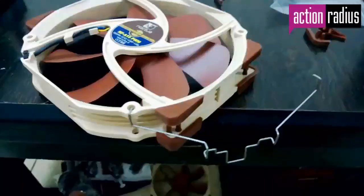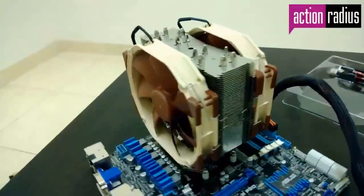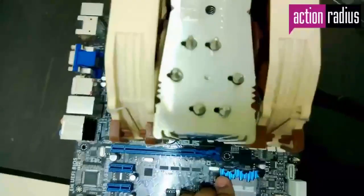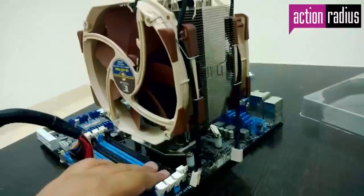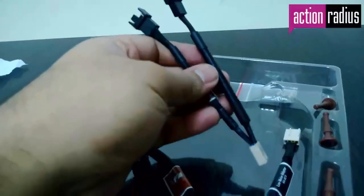Remove the thinner pads from the additional fan and install the thicker rubber pads that come with the heatsink. Next, put the spring locks through the screw holes of the fan, then install the fan over the heatsink — taking care that the spring lock is pulled all the way back to avoid vibration or loose play. Noctua recommends the suction fan run at 1500 RPM and the exhaust fan at 1200 RPM, as airflow gets restricted passing over the heatsink, so a slower RPM fan on the exhaust side works better. The additional fan has a Y-type power splitter connector allowing both fans to connect to one motherboard connector, or you can use a chassis fan port.